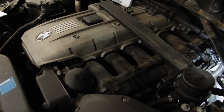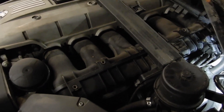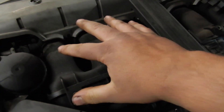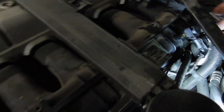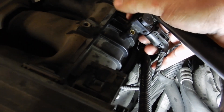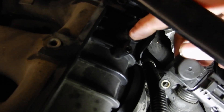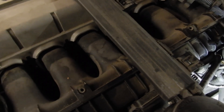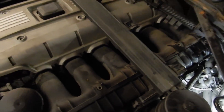A little bonus material for you guys. I want to prove that you cannot drive this system lean by creating a vacuum leak. Inside this intake manifold of this BMW, there is actually no vacuum. I'm going to prove it by removing the MAT sensor — and there is some airflow, but no vacuum. If any of you guys know why this is, please explain it to the rest in the comments section below. See you next time!